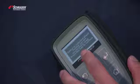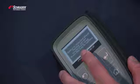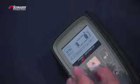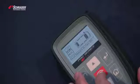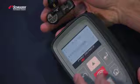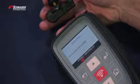The tool is telling us it needs to have a sensor in place, so we're going to go to the left front wheel position. We're going to select the OE sensor. With the Bartec Tool, you hold the sensor body towards the tool with the valve pointing away from the tool.